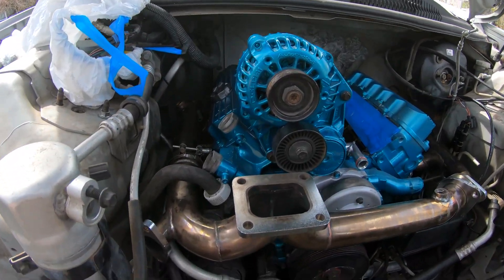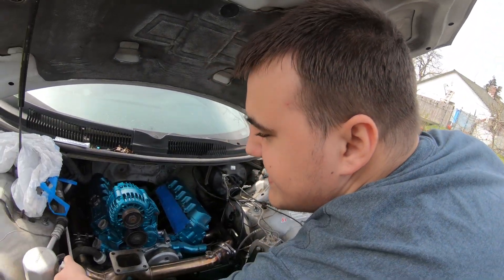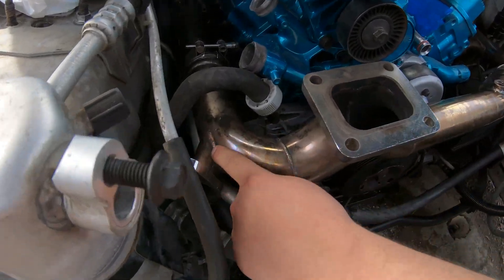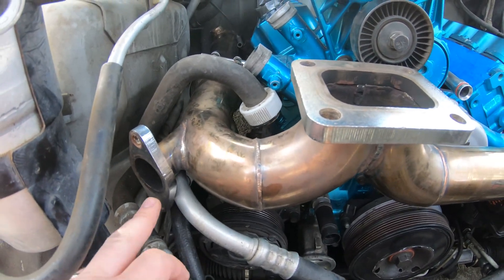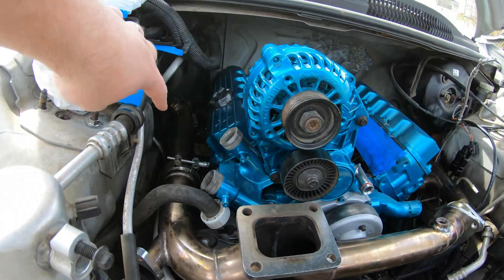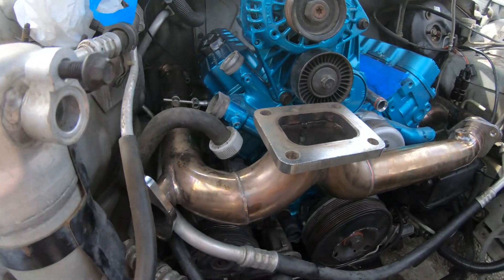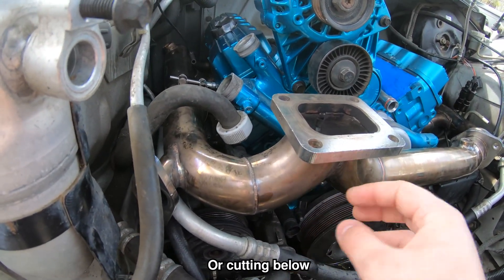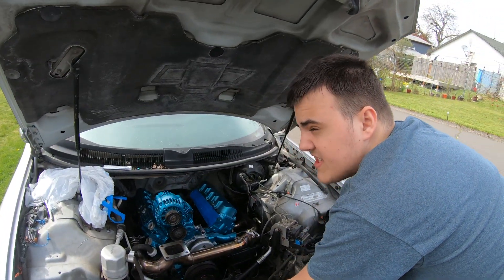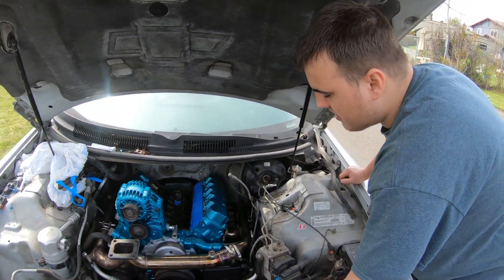So I unbolted it and it can't really go anywhere else, but it can at least move. I could probably take this bracket off and let it sit, maybe put it up against the side. We think we're definitely going to take this off and either replace it or just patch it up and put it somewhere else. This is like a 30mm wastegate, which only kind of helps on one side for exhaust gases. We're thinking of potentially cutting a section and welding in a straight-out 60mm wastegate — the bigger one. And that's what we're going to do.